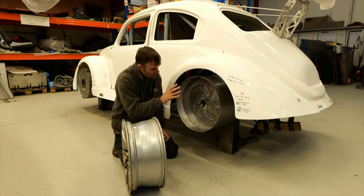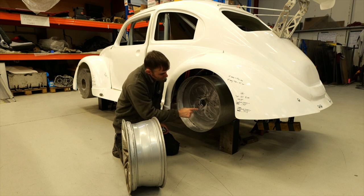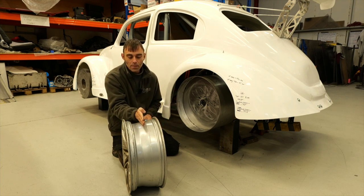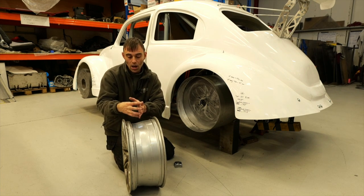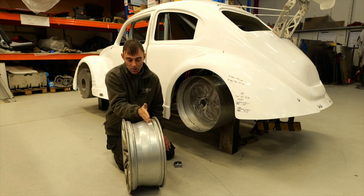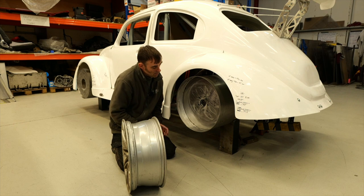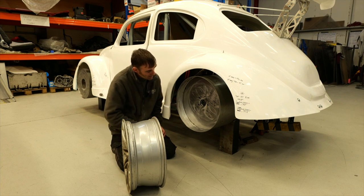We're going 18 inch by 10 on the back and as you can see it fits. You also need to ensure that the inside of the wheel clears the caliper as well. Offset is essentially the offset from the midpoint of the wheel - where the wheel actually attaches to the hub, which is very rarely right in the middle. It's usually offset a little bit either way. We're also trying to figure out what the offset needs to be here, which is why this surface is only three and a half inches in from the outside of the rim. The rear is pretty much there - 10 inch rim, 18 inch diameter.